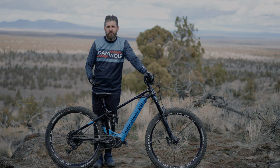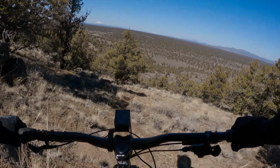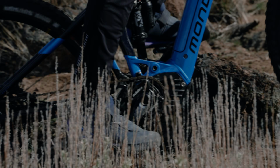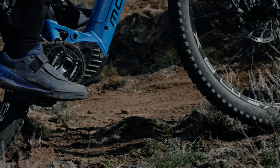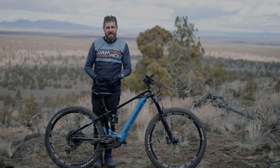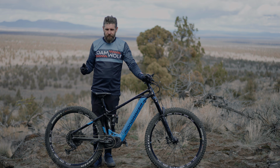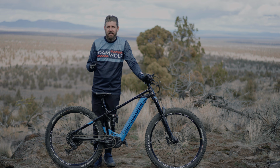We opted to run a smaller elastomer because we have lots of technical half pedal moves that we like to keep the bike as efficient as possible on, where we need to get quick bits of power down. And I will say it is noticeable that there is more lag before that drivetrain engages. However, the flip side is, it took a bike that was really fatiguing our riders, dinging rims, getting flats, and has really improved that quite a bit. It is a significant improvement.